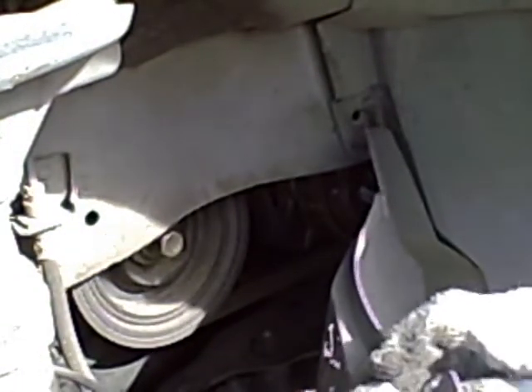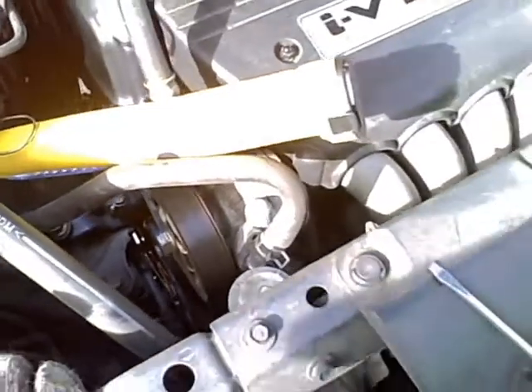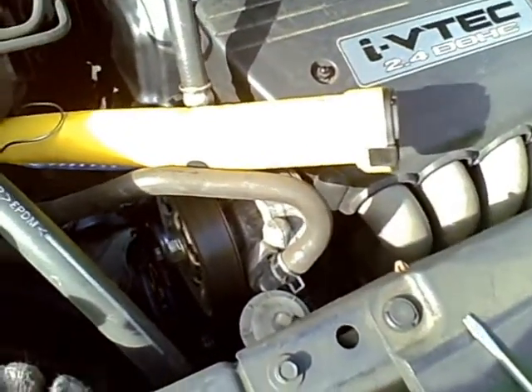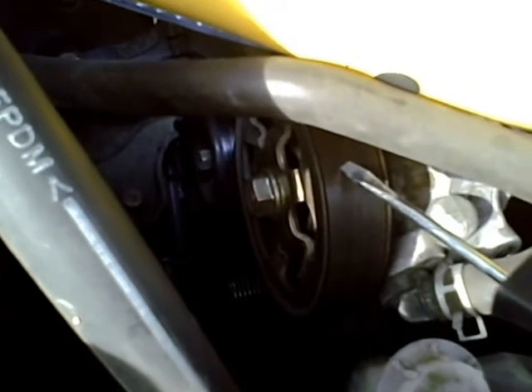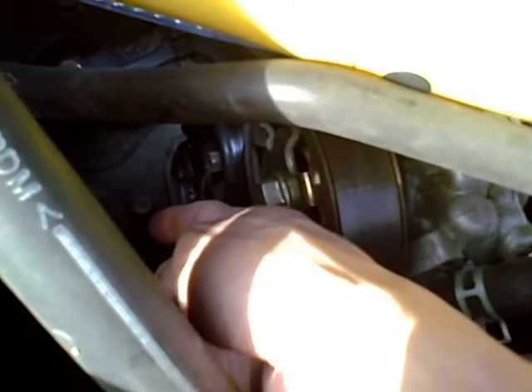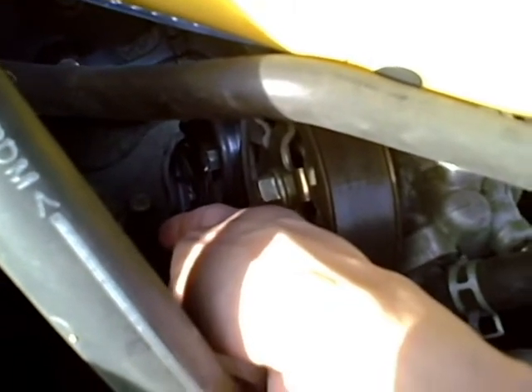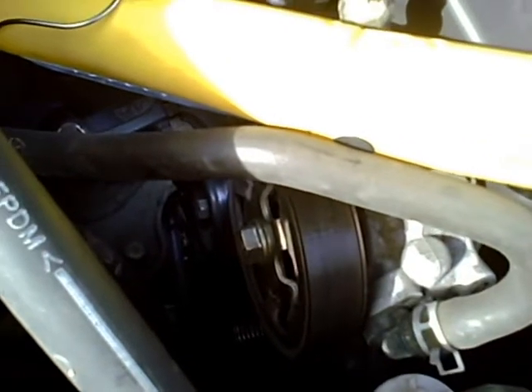Now that I have that plastic cover exposed, I can show you where the drive belt is from below. Moving to the top of the vehicle, you can see my light there, and you'll notice that this is the serpentine belt right here, and the tensioner and tensioner bolt are actually down there. It's on this tensioner and tensioner bolt that I will put a 14mm wrench onto, to pull and remove the serpentine belt.